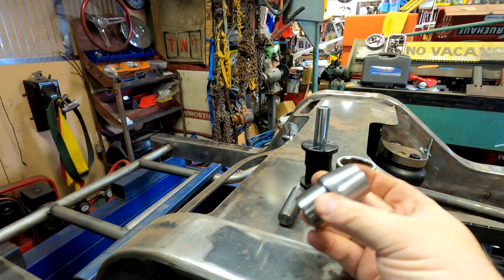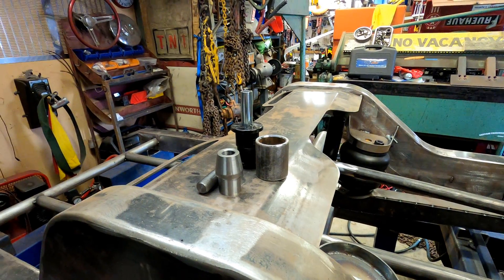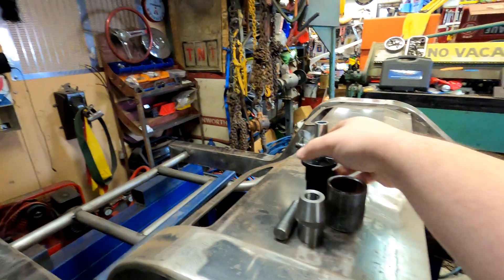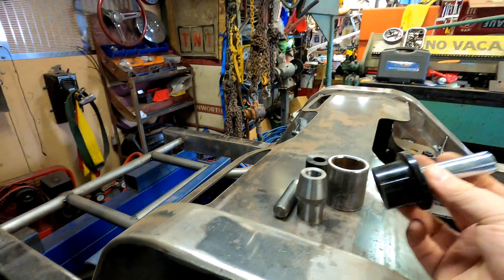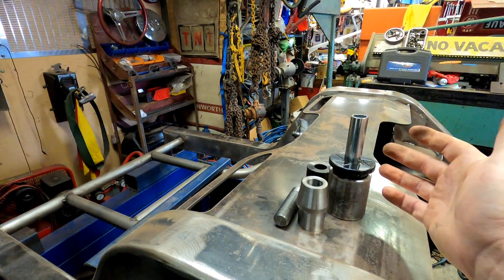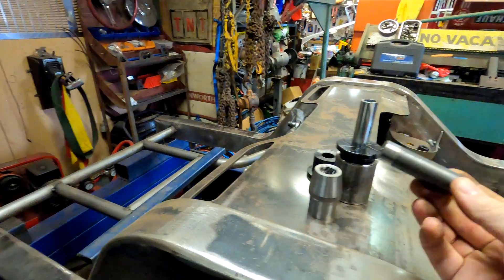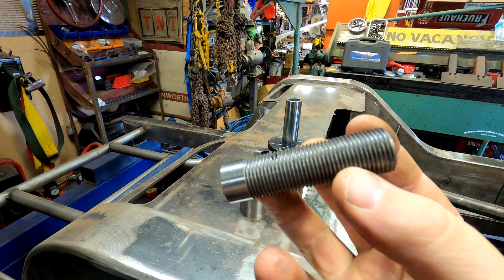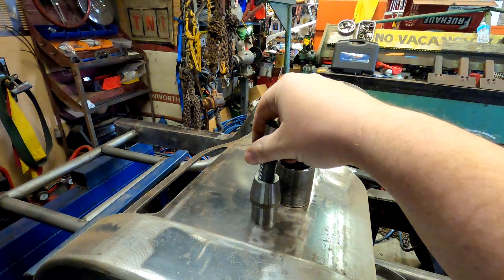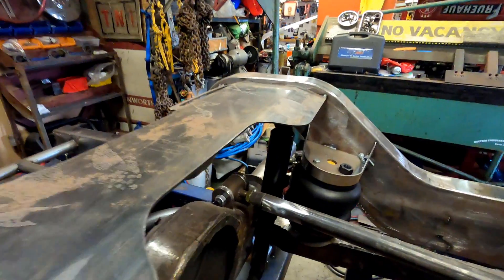This is the standard style. I just wanted to go through a few other components of four-links, because there are a few options when it comes to four-links as to what rod end you can actually use. So this is a kit that I actually do — a polyurethane bush with a crush tube, then nine-sixteenths, which go into the tube and we can weld that onto the end of our four-link. Or what we can do is weld a threaded insert on — nice weld all the way around — that screws in with a lock nut and can be used to make an adjustable four-link.